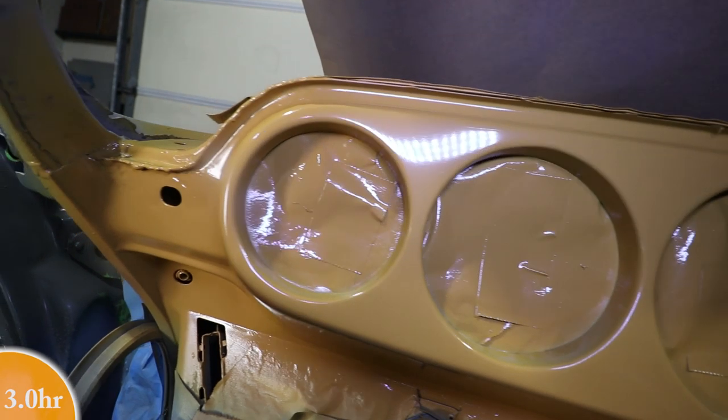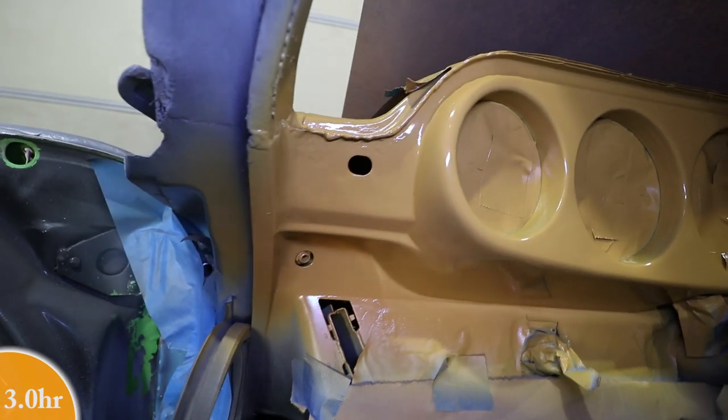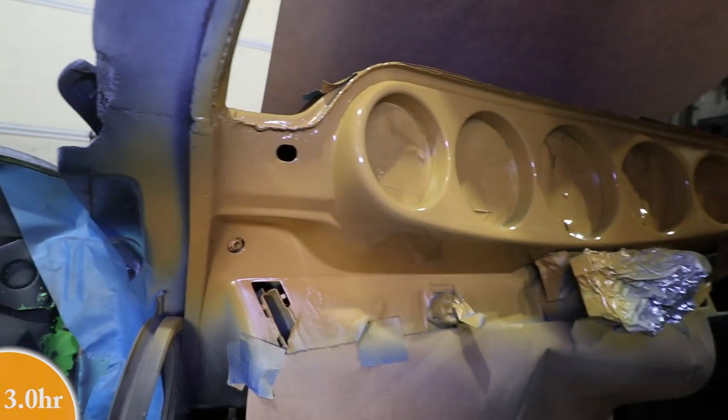When I came out this morning, there is a little bit of a dull to the gloss, and it is a base coat. I'm going to be putting the clear on just momentarily, but I was a little surprised at how well it retained its gloss even after 12 hours. So I did use the slow reducer. I did 30 minutes between coats. I'm new at this. I'm trying to kind of follow the rules, but I was pretty impressed with how it looks just as the base coat.